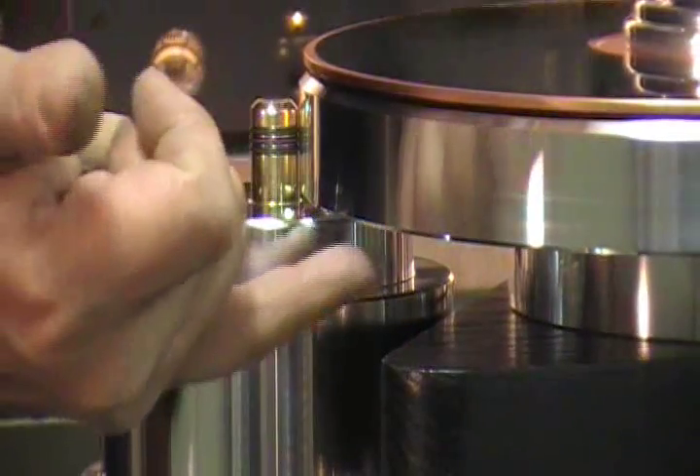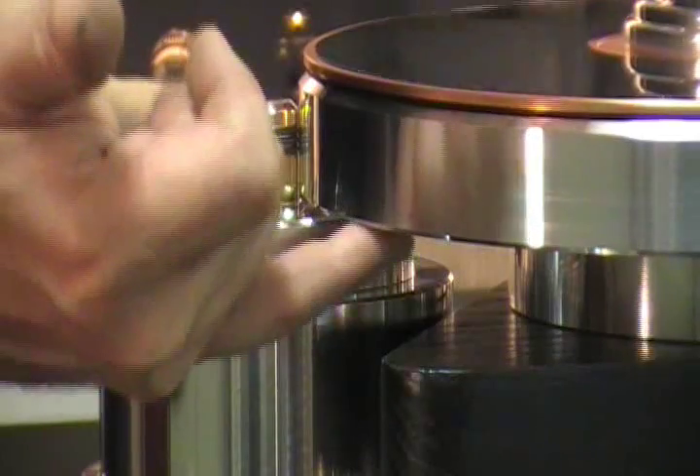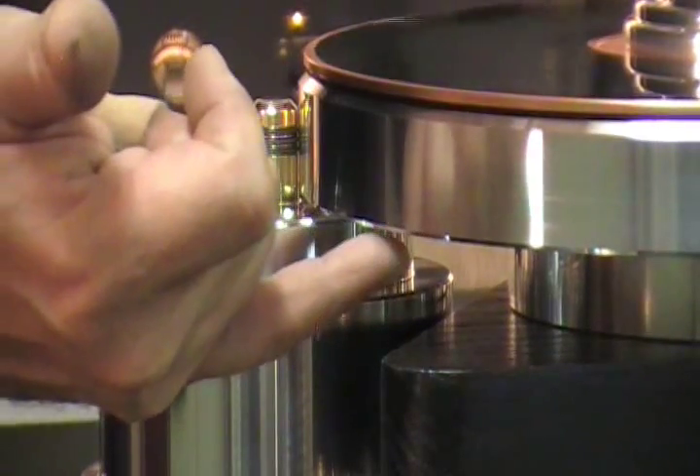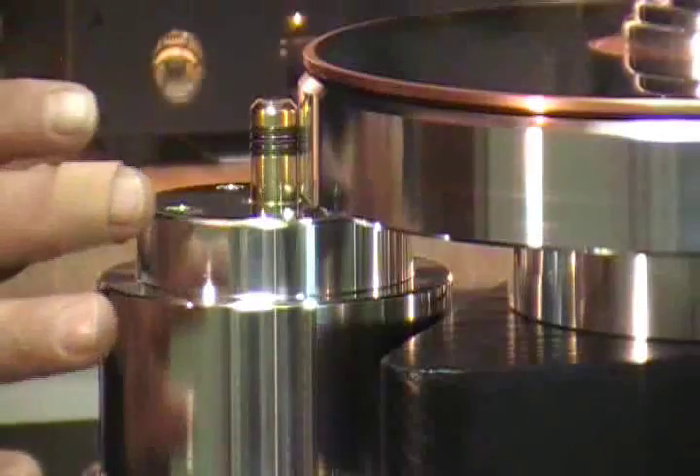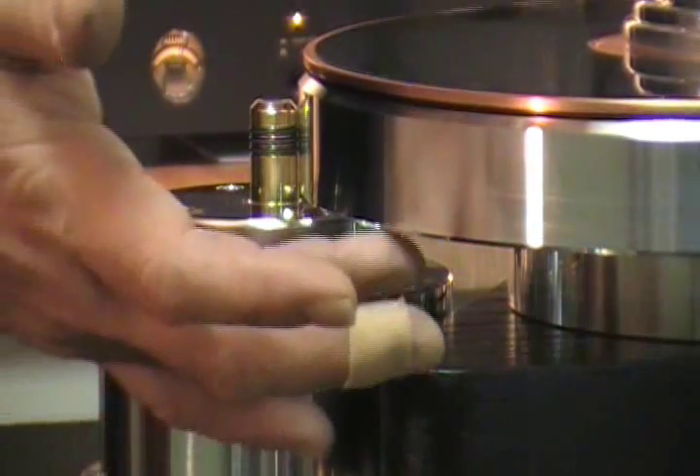Next, put your finger underneath the platter gently and make sure there is torque there. If it doesn't continue turning, then the motor is coupled too loosely. We're going to have a more detailed video on the setup of the motor, but it's about that simple.